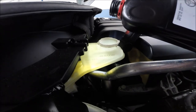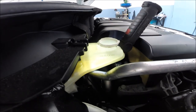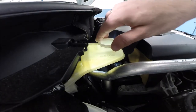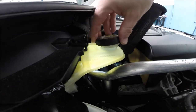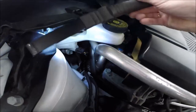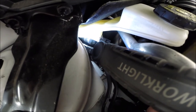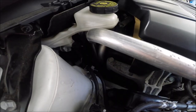So we'll need to add the fluid. Up to you, that depends how much you have on the brakes. I leave it below the maximum. Because the fluid level shows you as well when the front brake pads are finished, because it will be below the minimum. The minimum actually is here. So if the fluid is below the minimum, the sensor gives you the shout that something is wrong with your brakes. That's cool. Okay. 3, 2, 1, drop it.